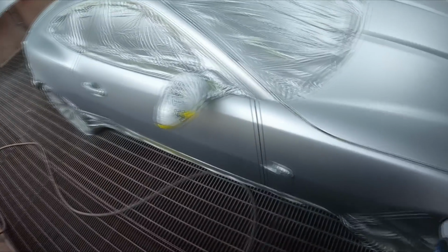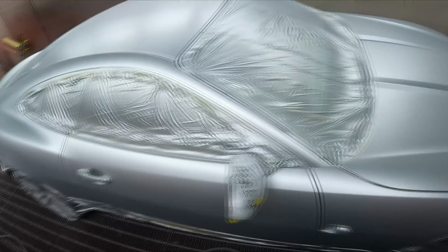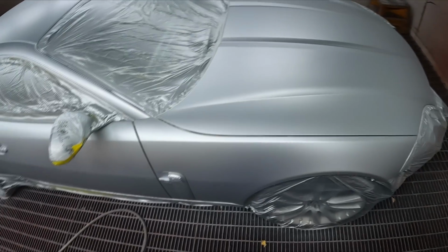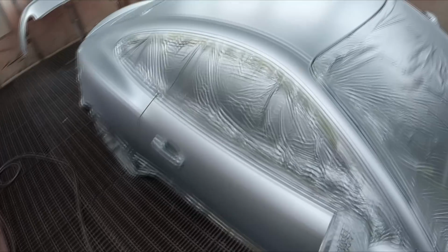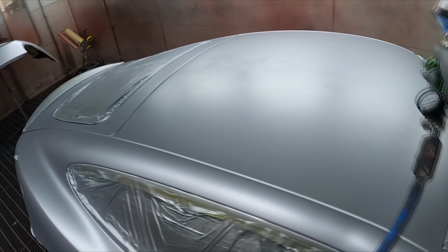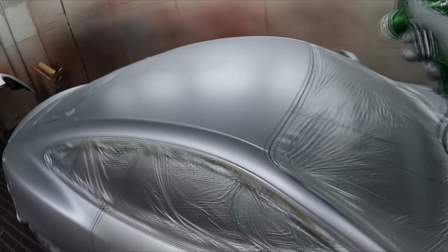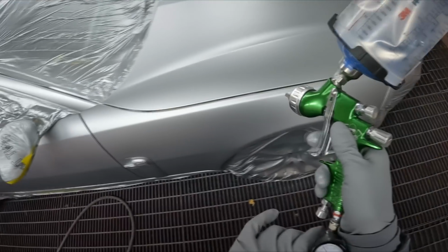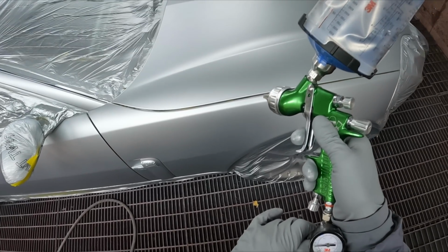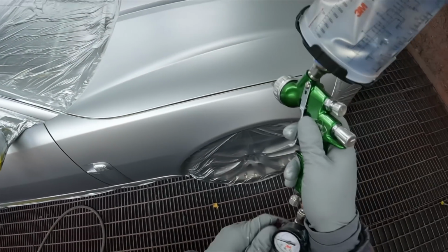Alright, time for our third and final coat. It's looking pretty good, it's drying down nicely. I see no edge mapping, I see no bad prep work, no deep scratches. That should be dry by the time we get there. Shouldn't take too long. I did find one chunk of dirt in the bonnet, but I tack ragged that out to the best of my abilities.